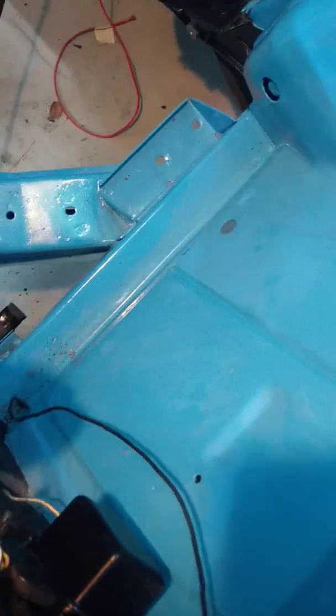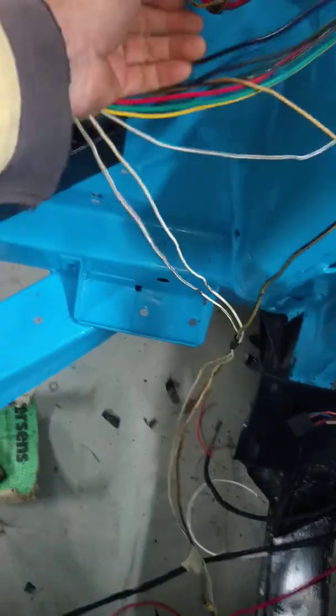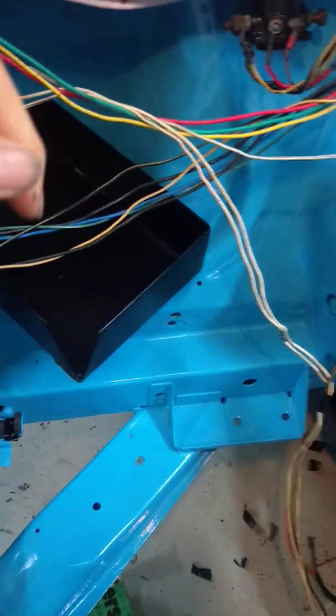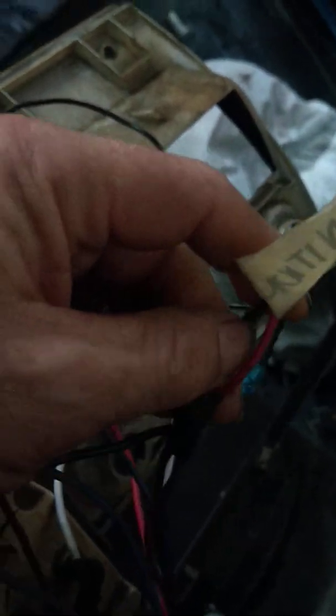I thought I'd just pull all the wires out of the voltage regulator. The yellow wire is just power that comes straight from the battery, which is not going to be used. The black and yellow wire is actually connected to a resistance wire and goes all the way through back into the dash to the ignition light — or battery light — and that battery light has got power coming into it and the black and yellow wire coming back out. That's the actual lamp wire.